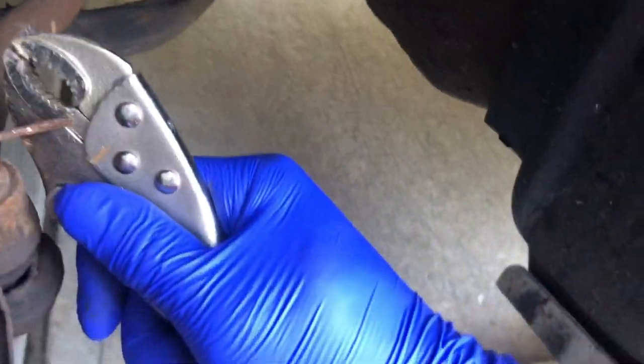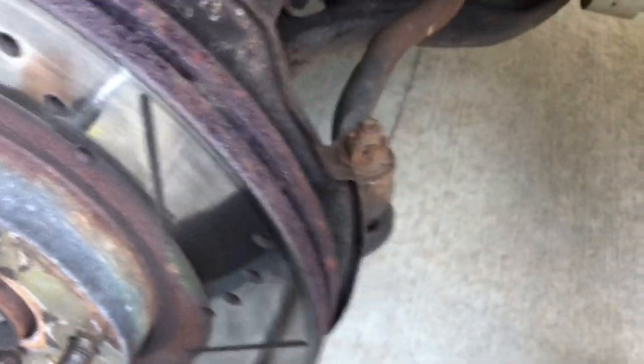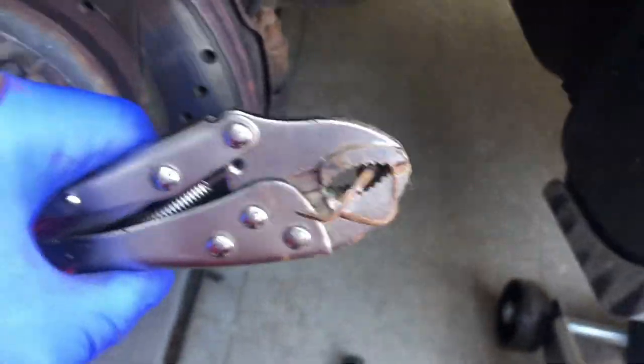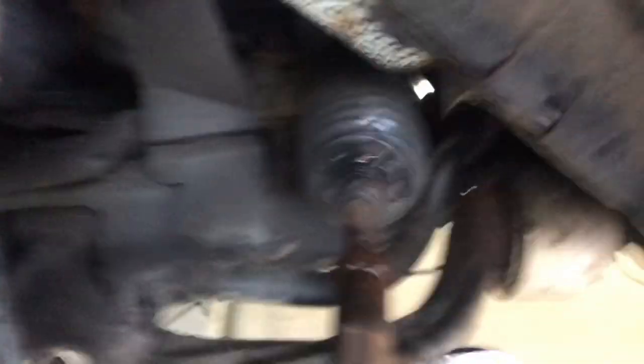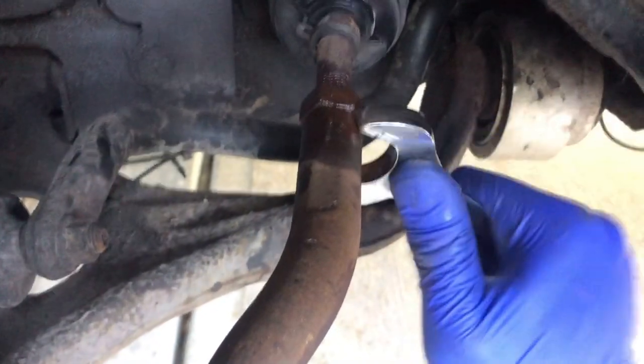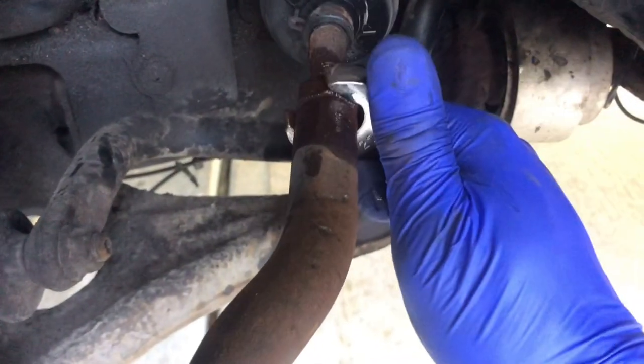Sometimes these are a little pesky — keep it straight. Got to bend it out a little bit to pull it, and basically it's going to come up. There we go — and that's your pin. So this part has to come loose. Mine is, as you can see, kind of rusted. This is a 21, and this is what you're going to put on here in order to break it off, because the point is to have the jam nut moving free. Now as you see, it's moving free.